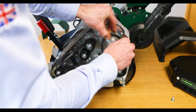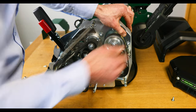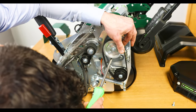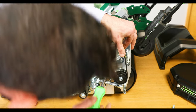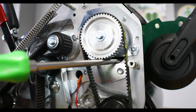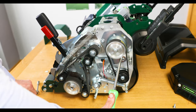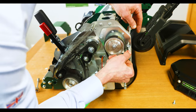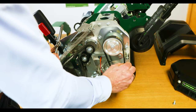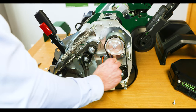To replace it, we need to put our tension back on to the top section. Underneath the pulley we can basically get a pry bar, which we can position between the two plates just to apply the tension while we're tightening the fixings. So then we can screw this fixing back into position securing the bracket. Ideally we want 4 to 8mm deflection on that.